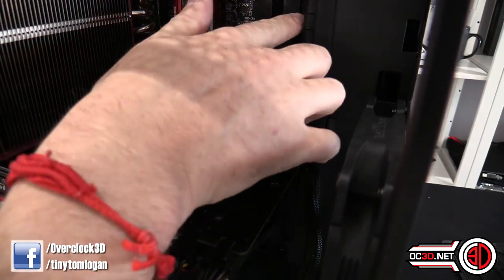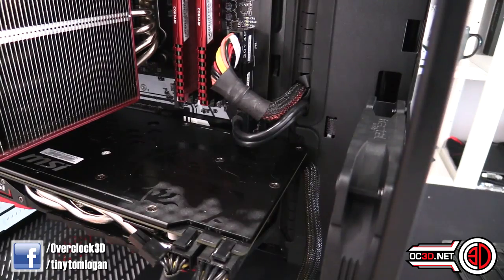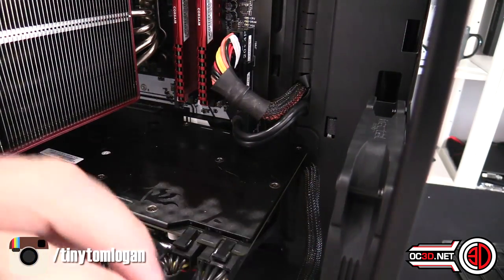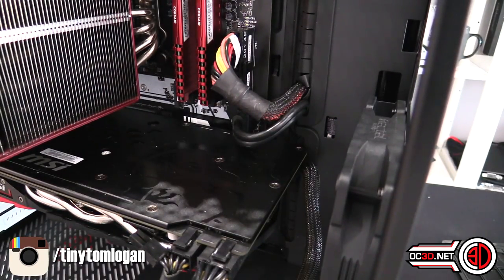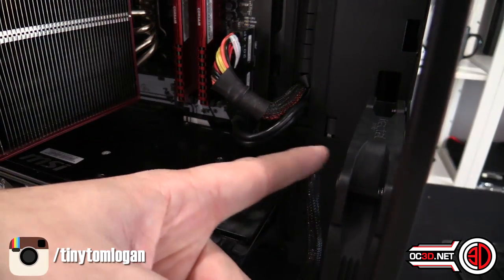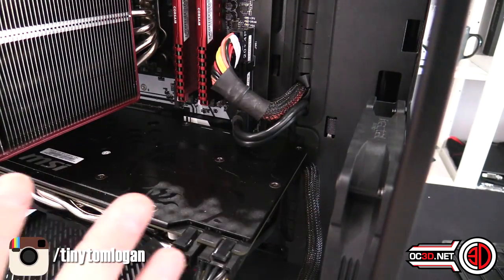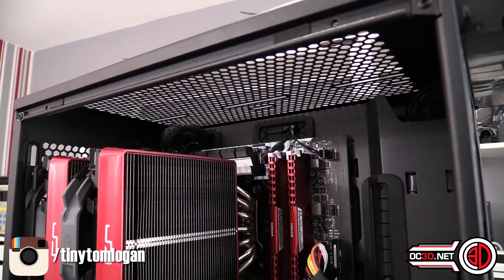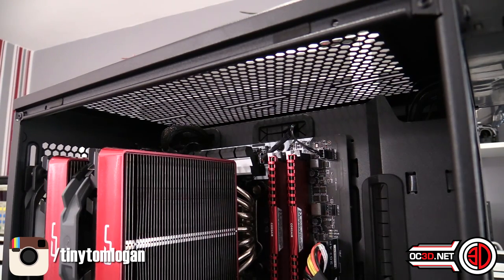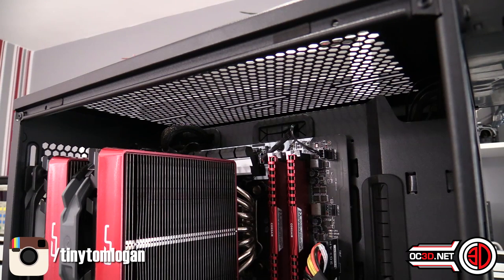With the cables in place, you can see you can get a really nice angle with them. It's also perfectly lined up with the ends of graphics cards, so even with a massive GPU coming right to the front of the case, it's not going to hit this area at all. One thing I'd say is if you're running a graphics card with an AIO that comes out the front, make sure you think about radiator sizes and where you want to put the actual radiator — whether that's in the front or the back. It's compact, so it just needs a little bit more thought.